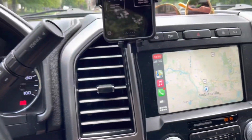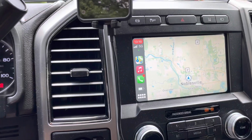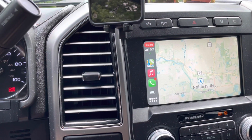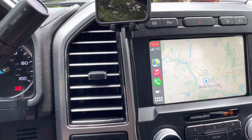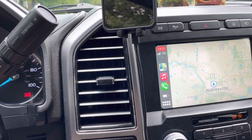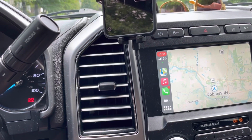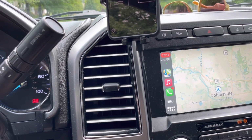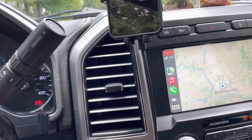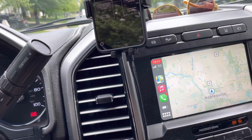One additional thing about towing with the Ford, regens. It regens a lot. My average distance between DPF regens was around 700 miles. On my Ram, it was probably double that. So that definitely affects the fuel mileage a lot, which is a good segue. So let's talk about MPG.